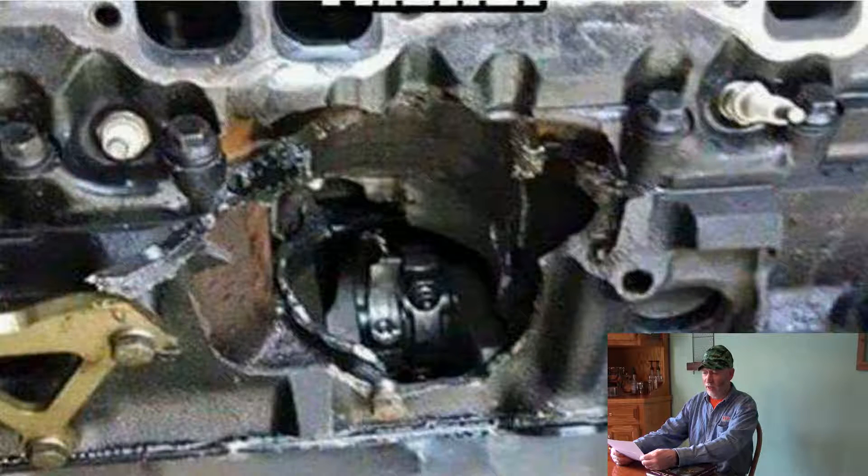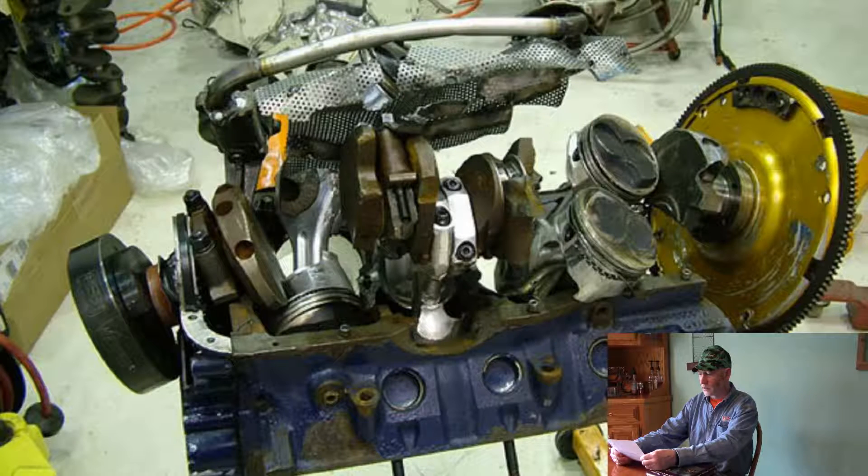You need to verify the engine condition while draining down the fluids. An example of that is look for cream-colored oil or light to tan-colored oil, which would indicate a crack from a coolant section of the block to the oil section of the block — either a cracked head gasket or intake manifold gasket leak.